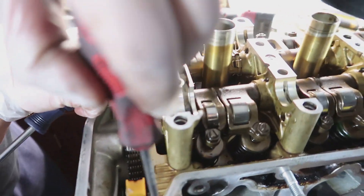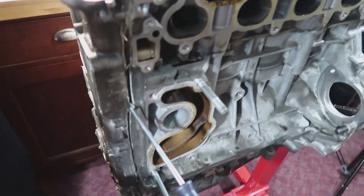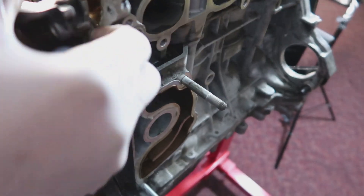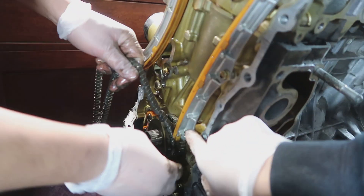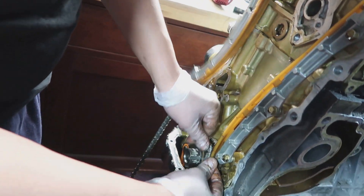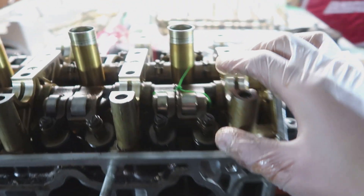Me and Andrel had one flat head on each side and basically we just pulled that off. There are also three 10mm bolts here. Right here you have the chain and here are the guides — they're 10 millimeters, three of them on each side — pull these off. And basically we're all set. As explained earlier, this is how you want to go ahead and put the rockers together.